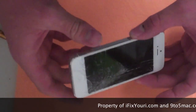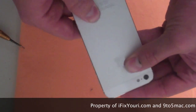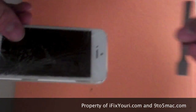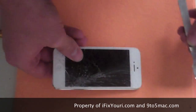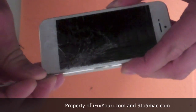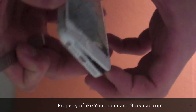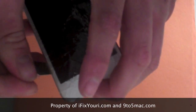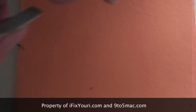Now on the iPhone 5, the back doesn't slide up like on the 4 or 4S, so trying to take it apart that way won't get you anywhere. What you'll have to do is get a flat tool such as this one here and basically pry along the sides of the phone. You'll start from the bottom by the home button and work your way up. Being that this phone is smashed, it may kind of fall apart, but we'll be as careful as we can without trying to shatter it too much.